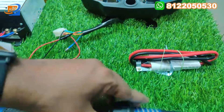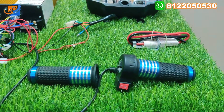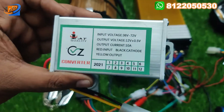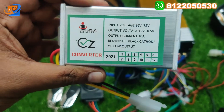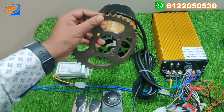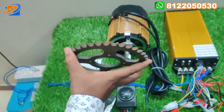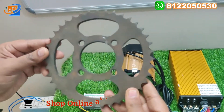The next thing will be the throttle — it is a forward/reverse throttle. For the BLDC motor we are providing forward/reverse without three-speed. We also have a DC-to-DC converter provided with the CVZ brand — this will convert your 48V to 12V to power your horn and headlight. We also have a 39-teeth sprocket to connect with the wheel attachment — you need to mount the chain assembly.